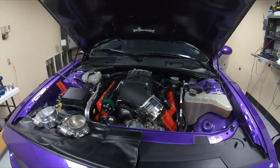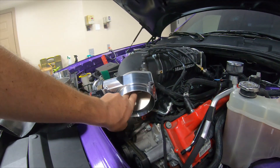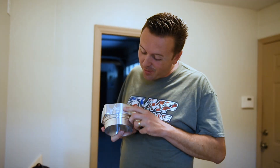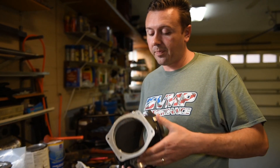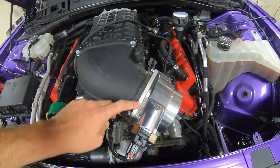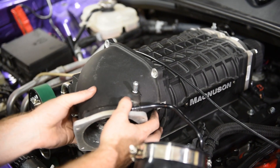We're not quite there yet, but we're working on it. When we found out that there was a 112 millimeter throttle body coming out from Kong Performance, we got our hands on one and I believe we're one of the first people to get one from Greg. I had to actually fabricate by hand an inlet to accommodate the 112. I took the regular Magnuson inlet, welded this flange on here, and ported it all out. We might have a picture we can flash up on the screen, but it is a ton of air into those beautiful TVS rotors.